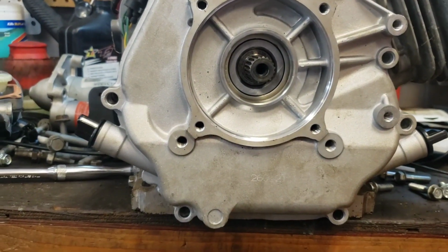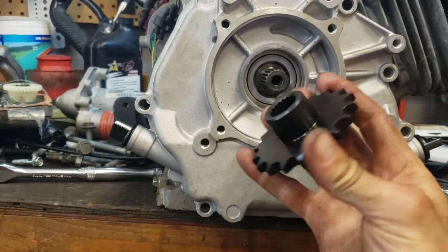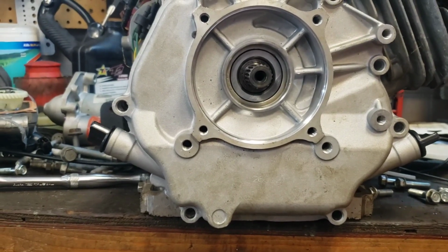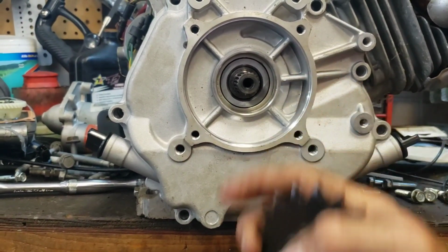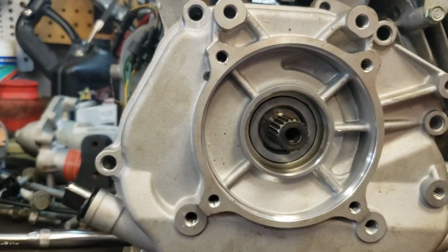That's also a little bit atypical, I would say. Typically, you're going to seal up against the crankshaft versus up against something that's riding on the crankshaft. And so I hope that's going to work out okay. I need to kind of think about that some more, whether oil is going to be able to get through the splines and leak or not. And I don't really know if that's the case.